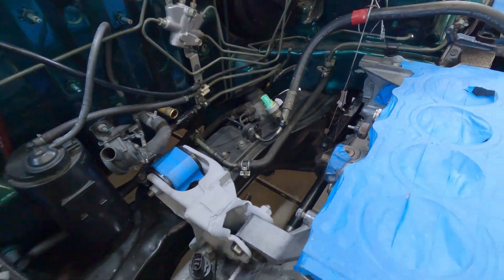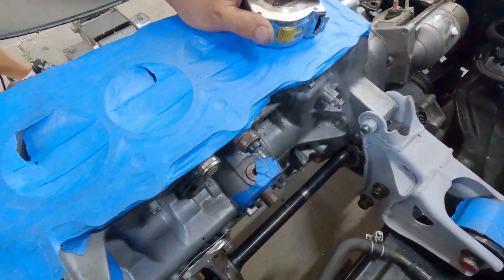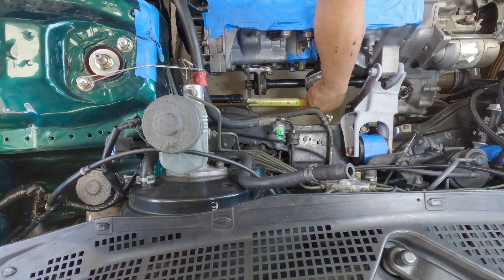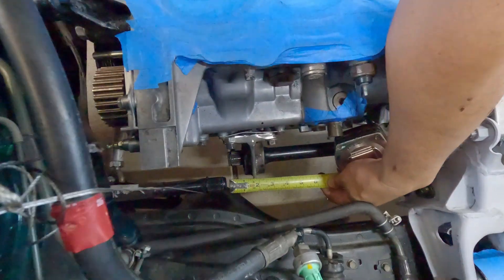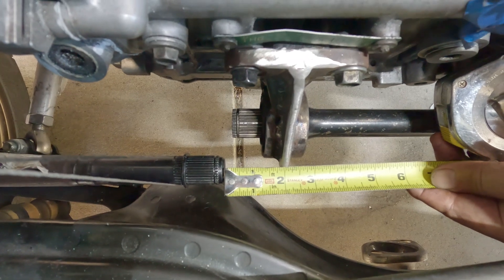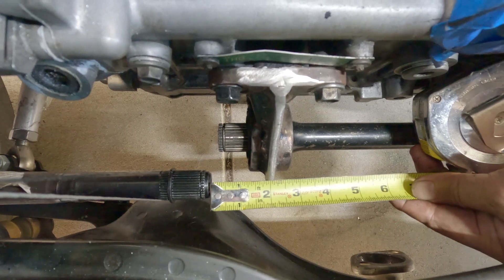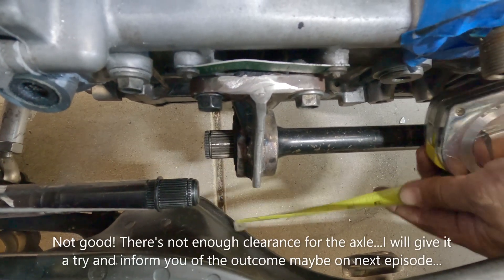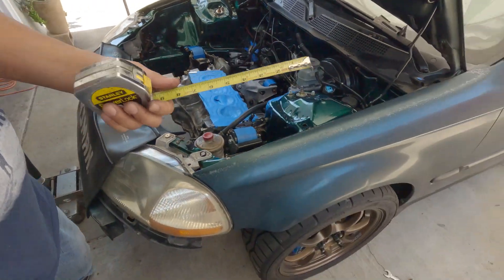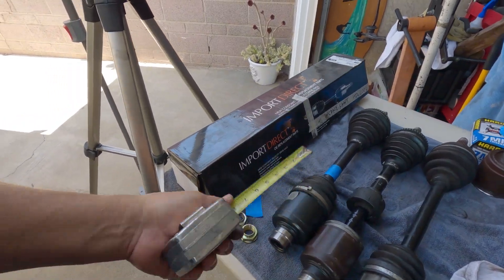Now on this side — that's how much gap. I'd say about half an inch — less than half inch, yeah, about 7/16th gap. That's horizontal, about 7/16th gap. All right, I'm going to jack this up, remove that axle, and replace it with the H22 shafts.